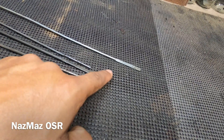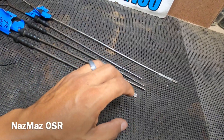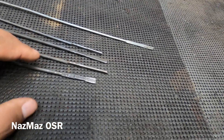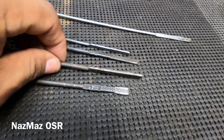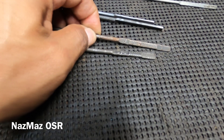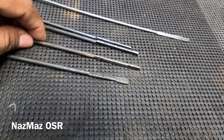If you pay attention here, the 13B dipstick is obviously a lot longer. So if you're using a 12A dipstick on a 13B and you're trying to check your oil level, it's going to give you a false reading. You want to be careful when doing engine swaps or putting together a Frankenstein engine. The full level mark sits a lot higher on a 10A than a 12A, so that will automatically give you a false reading. It could be like half a quart or a quarter of a quart difference, but with rotary engines that's a significantly large amount.